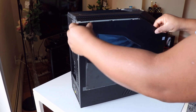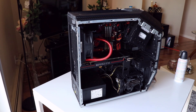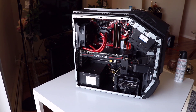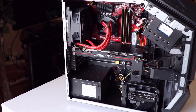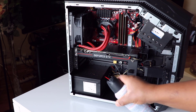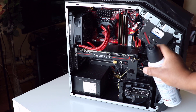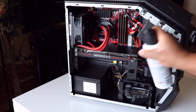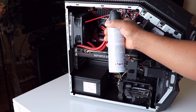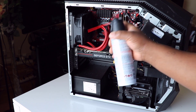On this model it is very easy to open — you can lift it up and as you can see, this is a giant PC. Let me zoom in so you can see exactly what it looks like inside. This is an Omen desktop. You want to spray from top to bottom, because if you start spraying from the bottom the dust will go up. When you start spraying, the dust will come out — you can actually see it. Don't spray too much directly on the fans, because the RPM of the fan will go so high it might damage it.